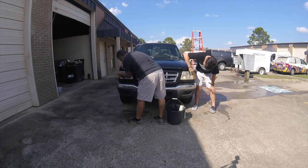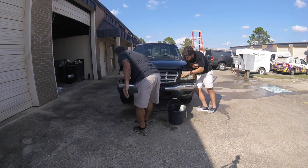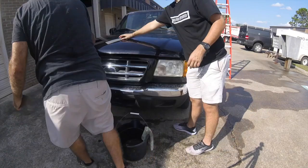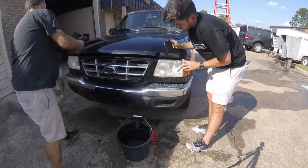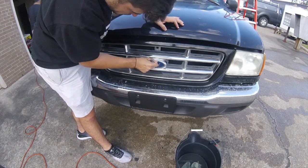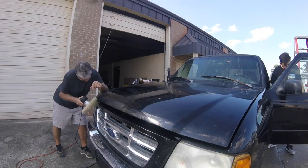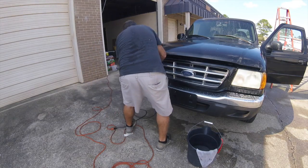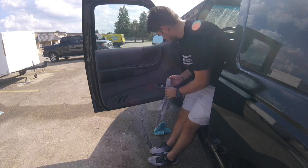As far as the headlights go, I kind of changed my perspective a little bit, because typically we would change out the headlights — spend about $80 to $100 and get brand new headlights. However, we were trying a different method with this one where we were just sanding down that top layer of the headlight, and then my dad's going to come back with the buffer. The finished product was actually very good, so I'm not sure if we're going to still buy headlights anymore. Maybe on the higher-end Ford Rangers we might throw some new headlights on, but this just went a lot better than what we expected.